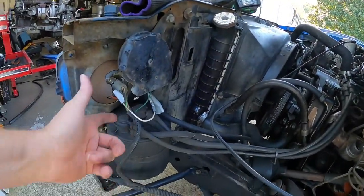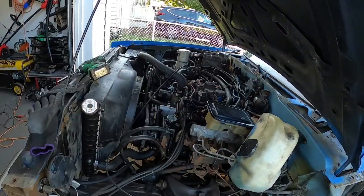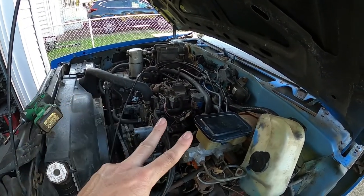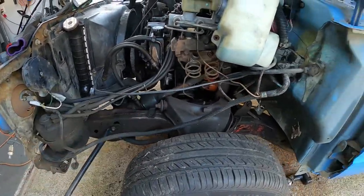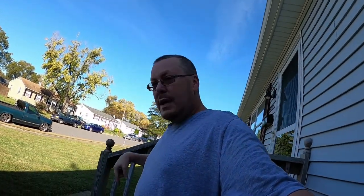The electrical wiring for the chassis we're going to keep, because that's the headlights and stuff like that. But I'm going to wind up redoing some of that because — that's duct tape. Anything that's electrical for the motor is coming out. The only thing I need on this motor is two wires: the main power that goes to the starter, and the trigger from the ignition switch that goes to the starter. Those are the only two wires I need — everything else can go. Well, so far so good. Now that I remember how to get this fender off, the other one should be no issue. We'll catch you on another day.